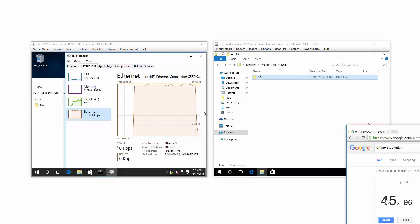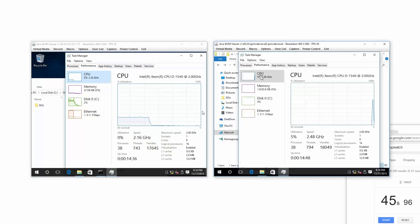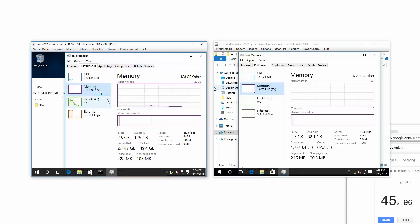About 45 seconds — awesome. So we learned a few things: 680 or so megabytes per second over the network versus 1.1 locally means 45 seconds versus a minute and 15. We also get very smooth performance — the 10 gig is behaving. Now I have something I can test when both Windows 10 instances are running as virtual machines under VMware ESXi 6.0 Update 1a. The only difference between the machines is one has 128 gig RAM on the left, and my machine has a more modest 64 gig.